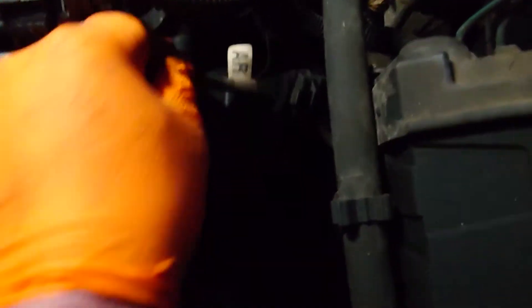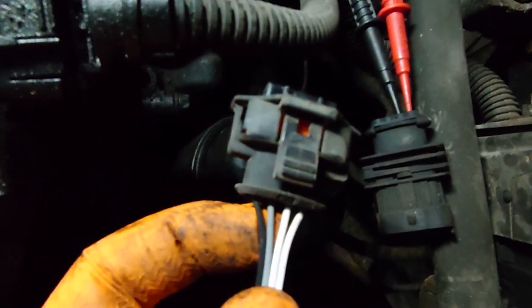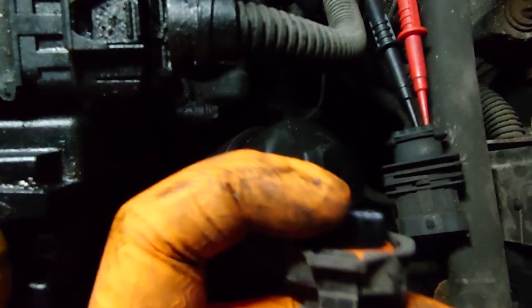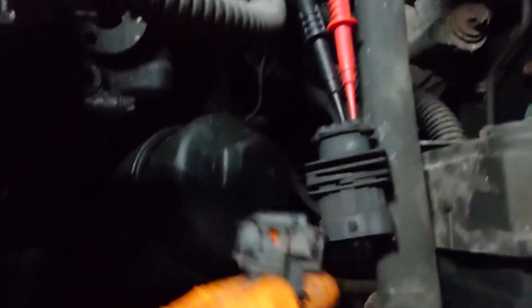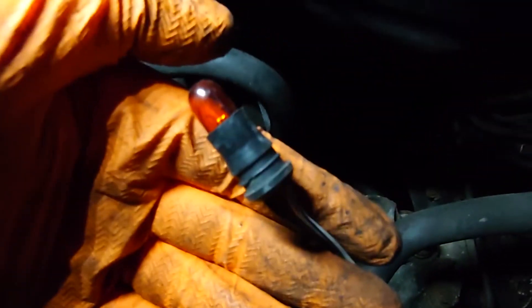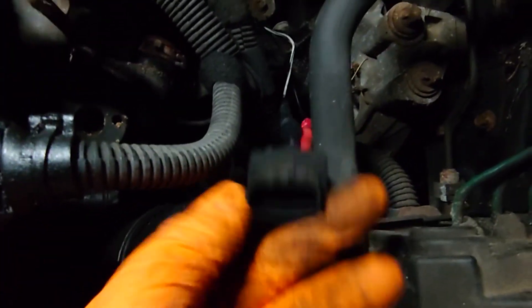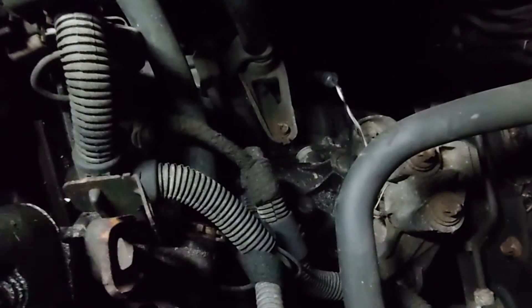I'll quickly just set up on this front one something similar where we can see the connector, so I can show you what I'm doing down the back there. This is just the front one — exactly the same as what you do on the back. You've got a grey and a black which are the sensor and sensor ground, then the two whites which are the heater circuit. We went into the two whites and checked the resistance. With the plug off, the two whites are these two on this end. We just back-probed it in up to a bulb, and we saw the flashing on and off — so we knew we had a good voltage supply and it would carry some current. That's basically exactly what we did down the back.